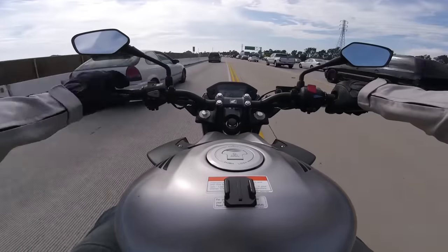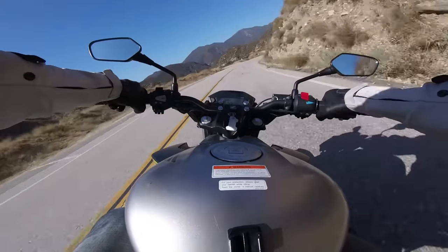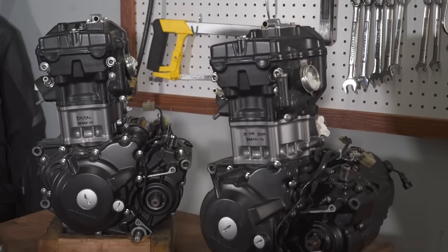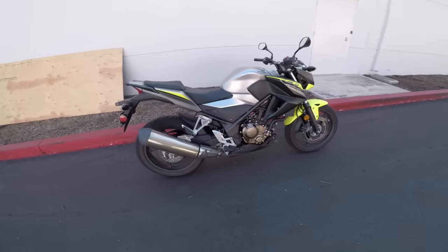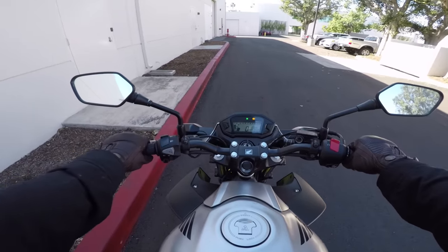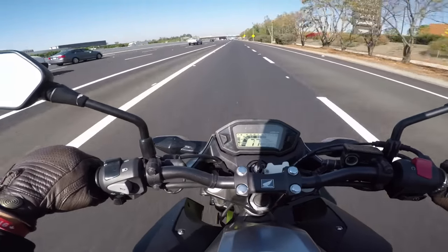Back in the MC Garage, I installed the first engine and broke it in gently as per the manual, painstakingly limiting and varying the throttle and slowly ratcheting up the revs over the course of a thousand miles. Then I swapped out for engine number two. While engine number one didn't kiss redline until that final thousandth mile, this second engine was given a minute to warm up, then ridden at or near wide-open throttle on the highways of SoCal for the entire thousand miles.